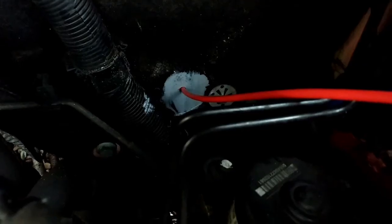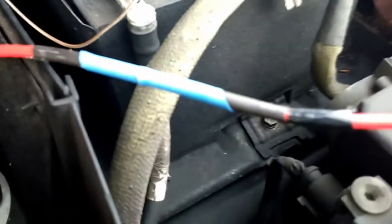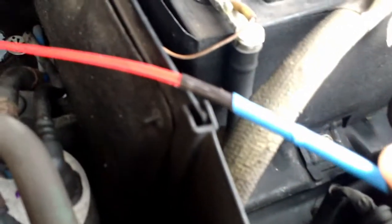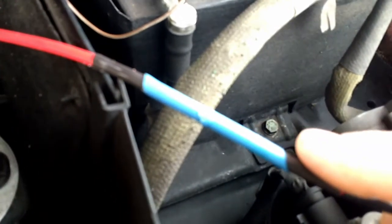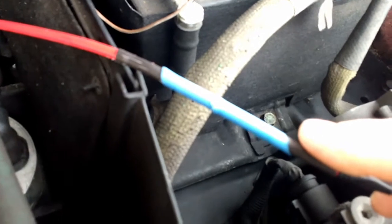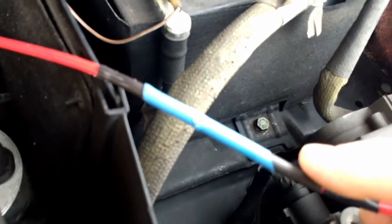There's the cable going through — I have to feed it through a bit further. I've put some heat shrink on the cable, double layer. That's where it's going to go through the bulkhead, and after that I'll put some silicone-type material to seal it, which won't be very much to seal because the hole is almost a perfect size for the cable, especially with the heat shrink.